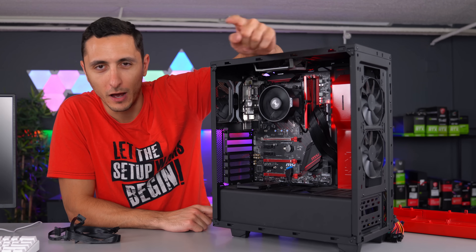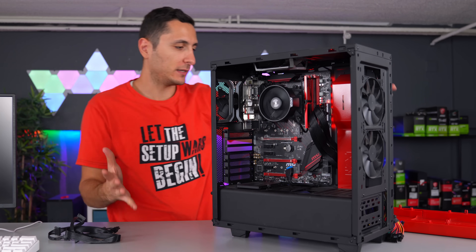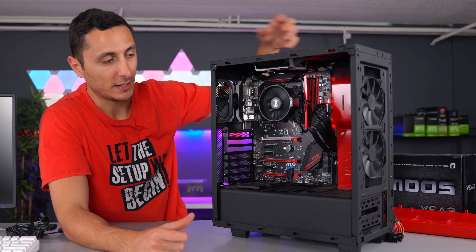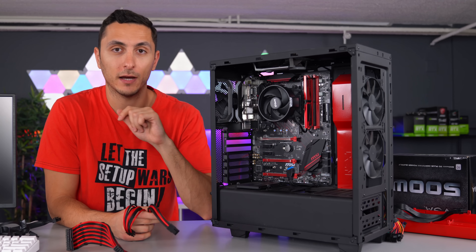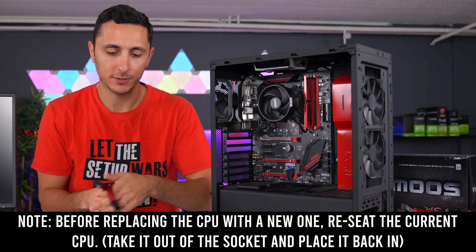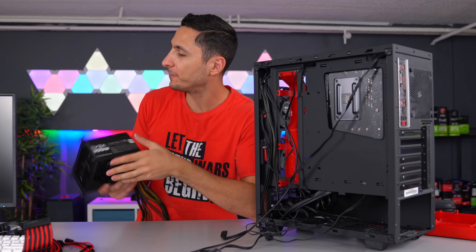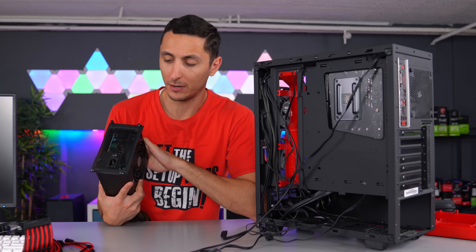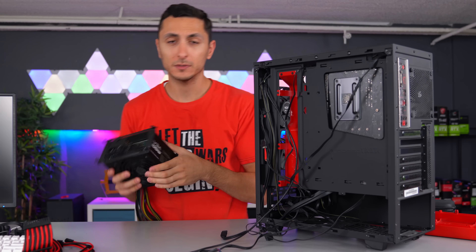How many of you guys commented correctly? I'm going to read the comment section and see if anybody guessed — I'm not going to read edited comments because I know you guys probably went back and changed them. Now that we know the power supply is the issue, we can put back the parts one by one to make sure everything is stable and working. If I had put in a new power supply and it still didn't post, I would move on to swapping the CPU, then replacing the entire board. I'm giving Tony another fresh EVGA 80+ Bronze Certified 500 Watt power supply — the same one I put in the original build. I've only had one other issue with this power supply in the past 10 years of building PCs, so overall it's a solid unit. I'm not sure how this one went bad — I'm not blaming EVGA or Tony — but it's not a bad power supply.